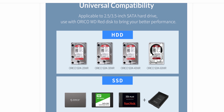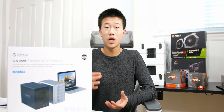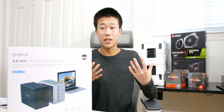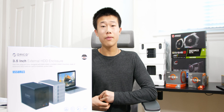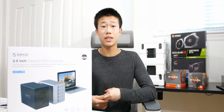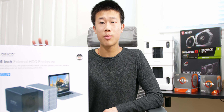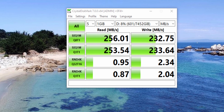You can also use 2.5-inch drives such as SSDs in this enclosure, though you might need a bracket because the SATA ports are at the very back and it can be hard to reach. With a 3.5-inch hard drive it's easier since it's larger, but for an SSD a bracket would help. I haven't installed any 2.5-inch SSDs myself, so I can't speak from personal experience.